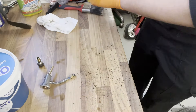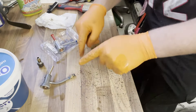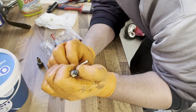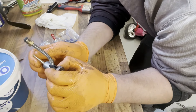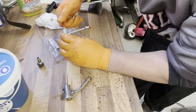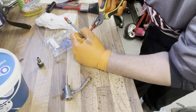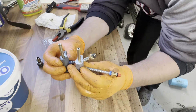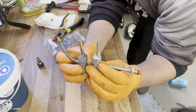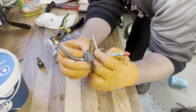Now this is part of my issue. I've got the new package - a couple of issues with regards to this. It has an O-ring on the end which is completely chewed. It's probably because where it's been sat for a while and it's got the fuel and stuff chewing into it, but that isn't great - it's not going to cause a great seal. It was in there pretty tight so I'm not overly bothered. The biggest concern is with regards to the angle here. If I compare this one to the new one - you can see the difference between the first one and the second one. I think what's happened potentially is that the engine steadies had a bit of play rocking the carburetor, and the carburetor hit on the back of the bulkhead and kinked that over.